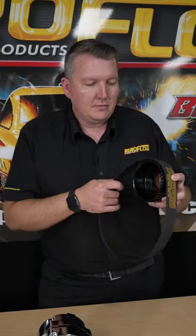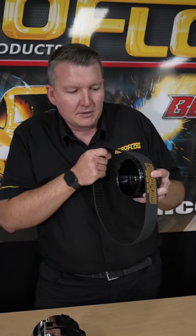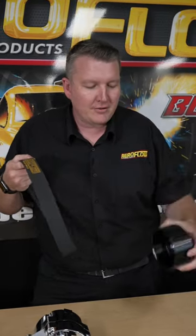Because it's a square design on that tooth, if you pull it really tight, when the belt slips over the tooth it creates a whine noise. We all know that sounds like a blower — it sounds cool, you give it a rev and people go, 'oh, is that a blower?' But no, it's just got a Gilmer belt that's over-tensioned.